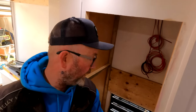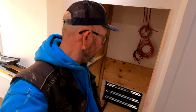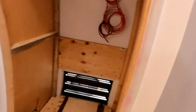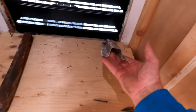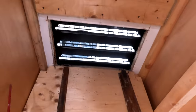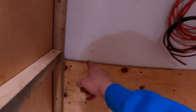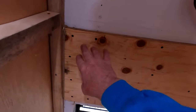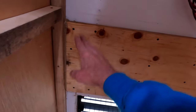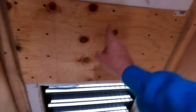Here's a quick step to show you what I did to create what you'd call a header in residential construction. I had to cut out the studs — one being a box square tube stud and another being a hat track structural. You can see existing stud lines running up and down there, and I've applied premium glue-all behind this panel.